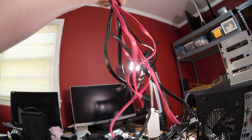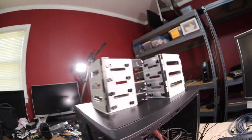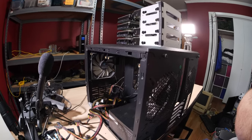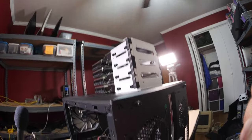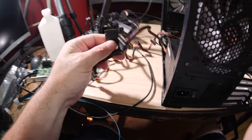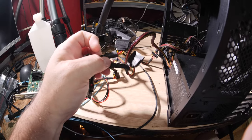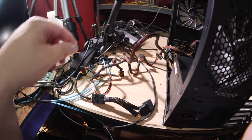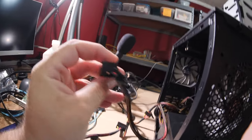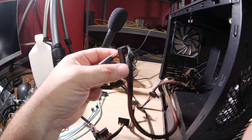I am the Lord of the Harvest. Kinda. Yeah. Okay. I'm being very goofy. Oh, look. Easy Stores. Tons and tons of Easy Store shucks. Well, now that I've revealed that those are all Easy Store shucks, you're probably wondering what I do about the 3.3 volt pin issue. I mean, you can use Molex to SATAs like these. If you use the wrong kind, like these, then the Data Hoarder subreddit will yell at you for being dumb and causing fires. But the other option is to take your lovely overpriced power supply and cut the 3.3 volt wire like a ghetto redneck boss.